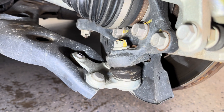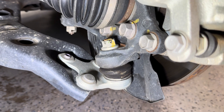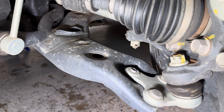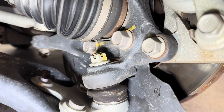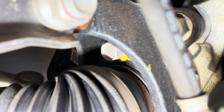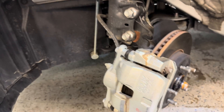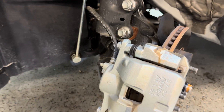Moving to the bottom side of the knuckle, we see the ball joint here, which is fortunately fairly easily serviceable as it bolts to the lower control arm — this L-shaped unit that's pretty standard on a lot of front wheel drive cars. Right above the ball joint we see a couple of bolts, and those actually hold the hub assembly in place, as this has a package unit with the hub and bearing that can bolt onto the knuckle directly.